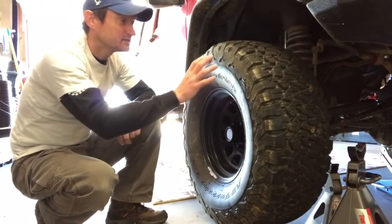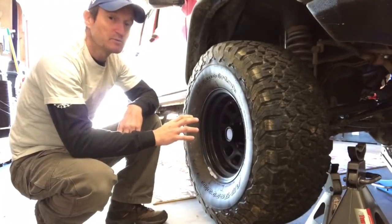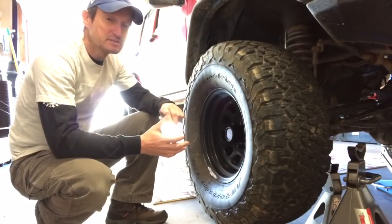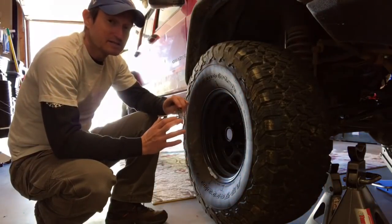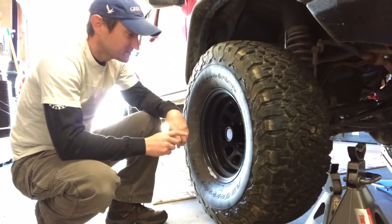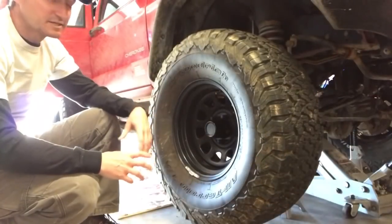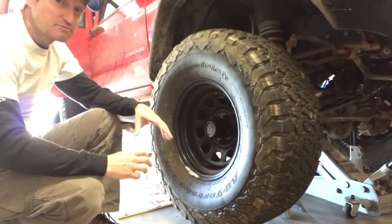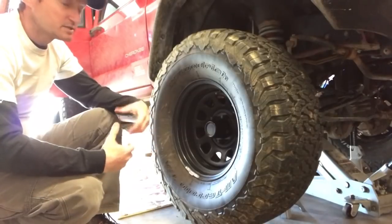Some people also take off the tie rod end, and I'm not going to do that either. I'll show you how to avoid that. You might want to consider doing those steps if you're worried about the weight on the axle shaft when you remove it and put it back in — that might be why people go through those steps. Anyway, I'm going to leave all that attached and show you how to do this in as few steps as possible. One important thing: wear eye protection, especially when doing ball joints. There's going to be a lot of things under heavy pressure, and when things go flying they go really fast. So first we'll finish loosening the lug nuts and remove the wheels.